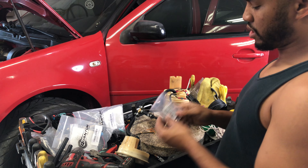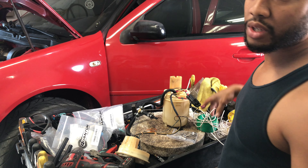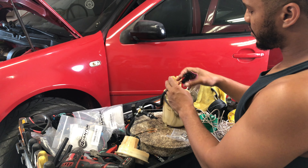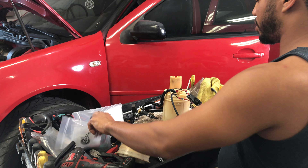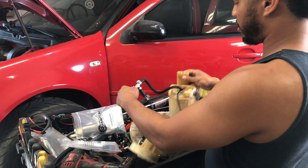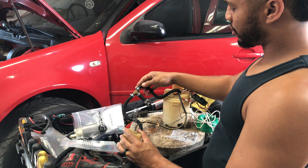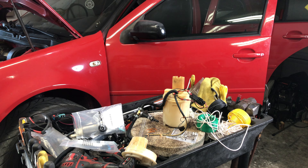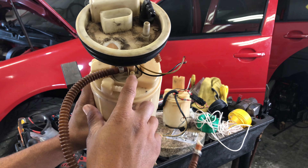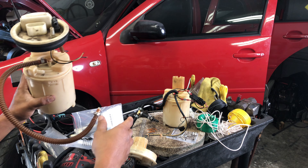I'm going to pull out the pump and get everything assembled. I've got a 3/8 by 3/8 wire connector, a bunch of different wires for making the secondary relay, and some better quick connectors — the ones I have now are a bit exposed, so I'm switching to ones that cover each other. This is what we're working on. The R32 and TT have this nipple that comes right off the pump and sends fuel to the pickup, which pushes fuel back to the pump.